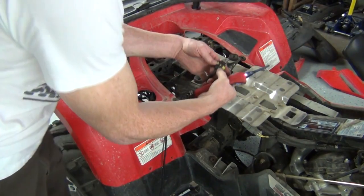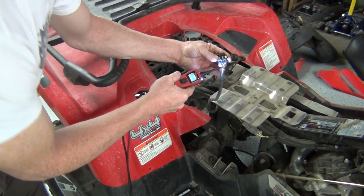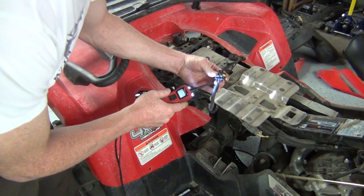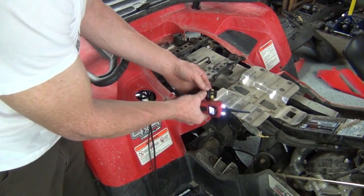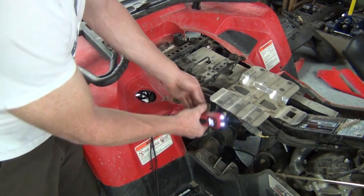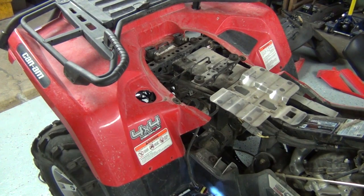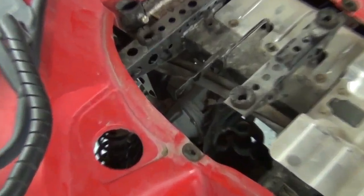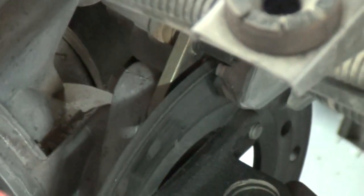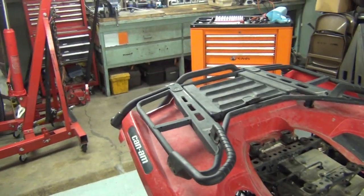The blue one is your power wire that's on all the time when the key's on, and then this outside black wire is your ground. The way this is oriented - where the clip is, it'll be upside down in the center right over the drive shaft. If you look down in there, you can see where the drive shaft and the drive shaft brake rotor are. So this plug will be right over the top of those on the gas tank.